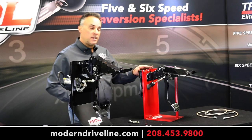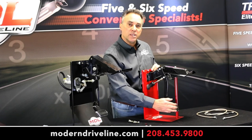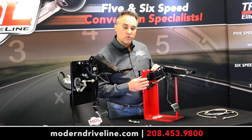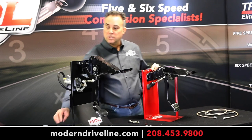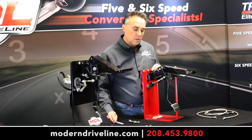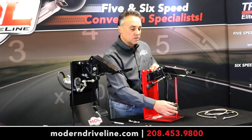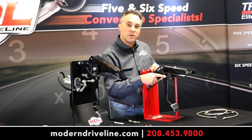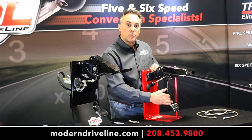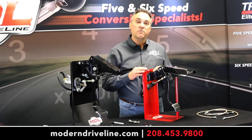Moving on to our direct connect systems — similar action. The rod will move in an articulating motion in and out of our master cylinder. To verify that you have the correct amount of movement, again you can take your sharpie marker, mark here, mark here when the pedal is all the way down, and see how much movement you have. All of our systems are designed to use factory pedal stops and come all the way against the factory pedal stop or bump stop, and actuate completely through the stroke down to your carpeting at the floor without the need of a pedal stop.